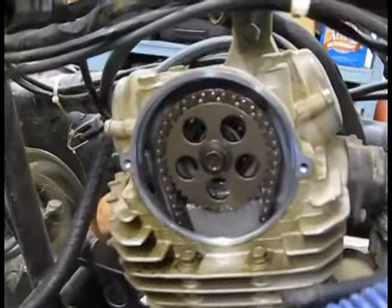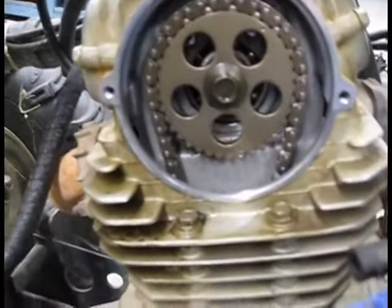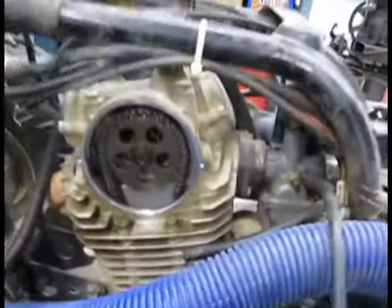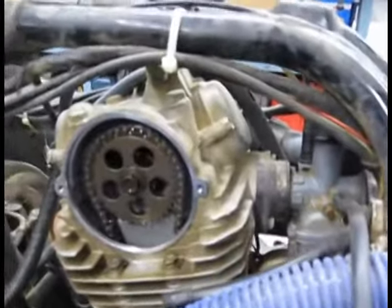Just in case you were curious as to what was leaking — here's your o-ring, there's your cover, there's your cam gear, top of the head. Anyway, we'll put this seal back on and seal it back up, and that should take care of that oil leak. Minor repair while I'm trying to figure out other ways to mess with my little Bayou.